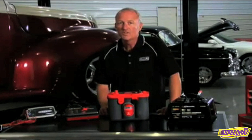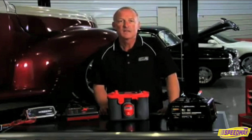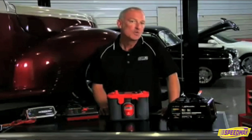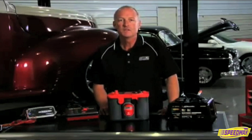Typically, we only see issues with charging when it relates to stand-alone deep cycling applications or if the battery has been severely discharged. The bottom line is that under normal usage, where the Optima battery is not being deeply discharged, almost any battery charger will work just fine.